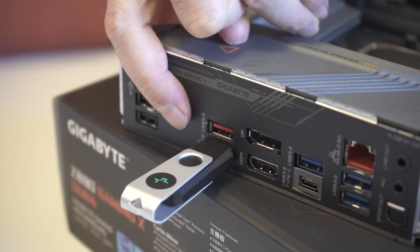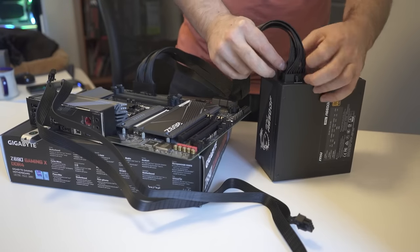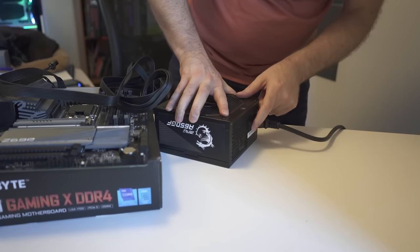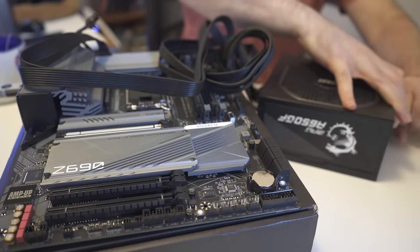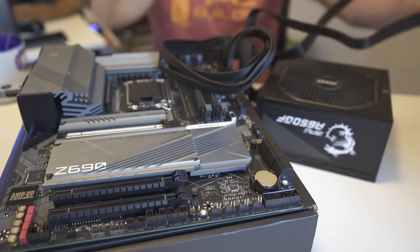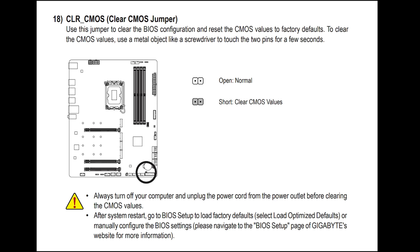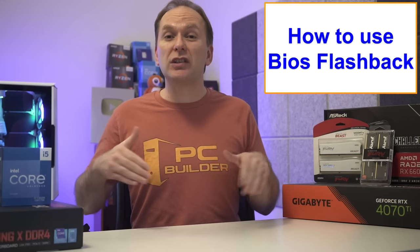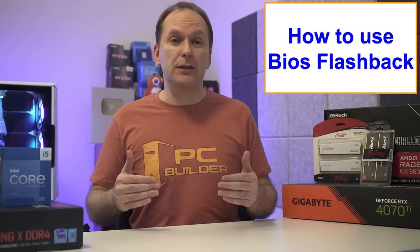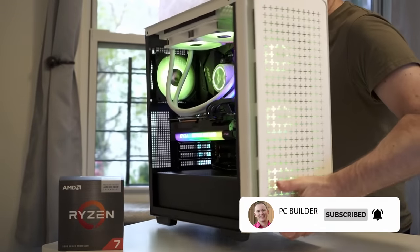Now let's flash your BIOS. Make sure the USB drive is in the correct port for the BIOS flashback, that the EPS power cables in the upper left corner of the motherboard are connected along with the 24-pin motherboard power connector on the right side. Make sure the PSU is plugged in and turned on. Push and hold the BIOS flashback button until you see an LED start flashing on the motherboard. Leave the board alone until the light is done flashing — typically one to eight minutes. Once done, wait another 20 seconds, then power off the PSU and build the PC if you haven't already. If you have trouble posting after updating, follow your motherboard's instructions on how to clear the CMOS — either pushing a button on the board or using a screwdriver to bridge two CMOS pins. Your PC might reboot several times continuing the BIOS update, so just leave it alone until it finishes.